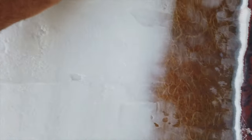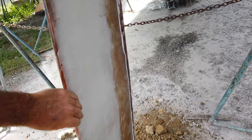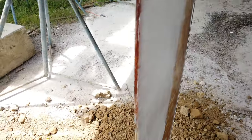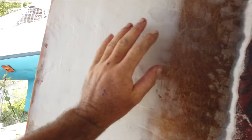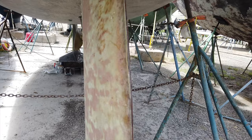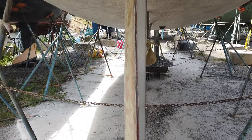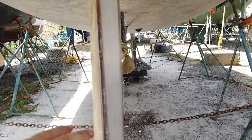I'm going to take the grinder and knock down all the rough edges, smooth them off as best I can. Then I'm going to refill using a softer, lighter filler. The reason I didn't put a lot of the hard filler on is because of how hard it is to sand — I want the final surface to be with the lighter filler so I can sand and really get the shape right. This side is still definitely wider, so I still need some filler on this side, but we're getting there.